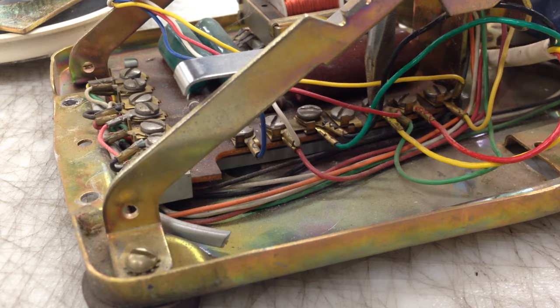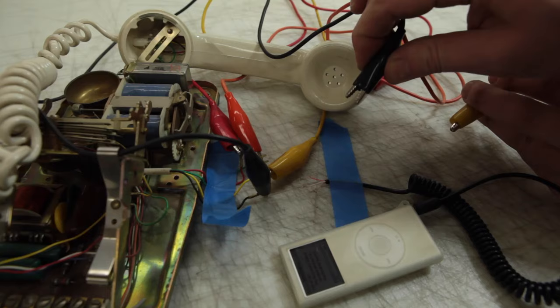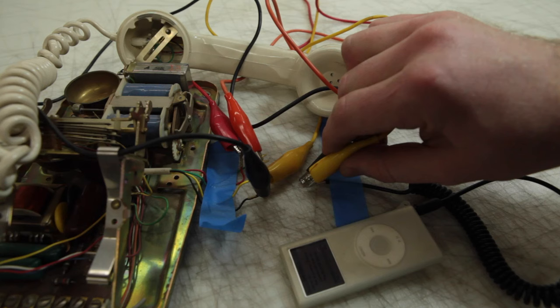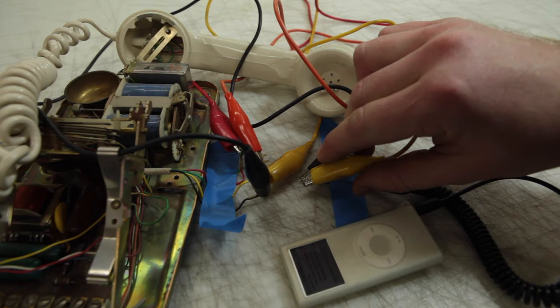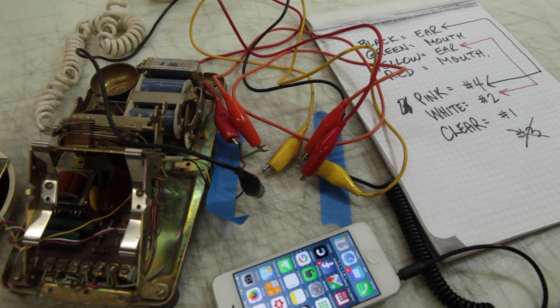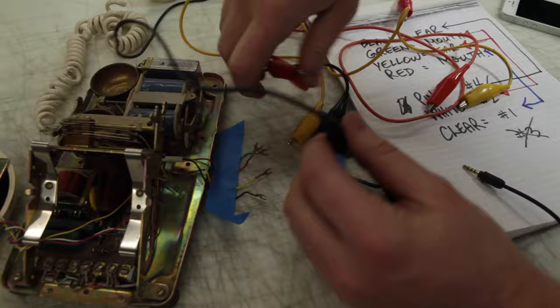I disconnect the four wires from the telephone handset so I can connect them directly to the cell phone cord. I connect the black wire of the handset to the pink wire of the cell phone cord and plug it into an iPod. I connect the yellow to the clear just to see, but I know it will be the white ground wire that will make this work. Filling out my wiring diagram helps me keep it all in check. The speaker is the same — white for ground and clear for audio. Now that everything's been tested, I can disconnect all of my test wires and get ready to permanently install these two wires together.